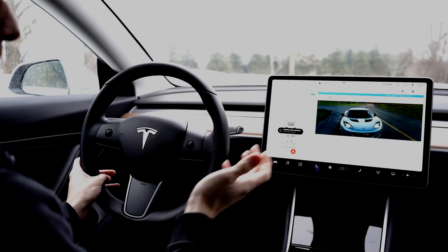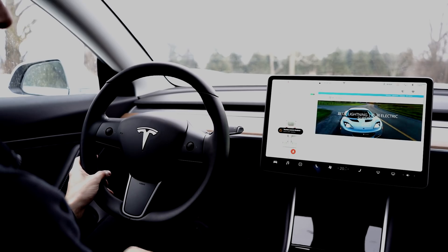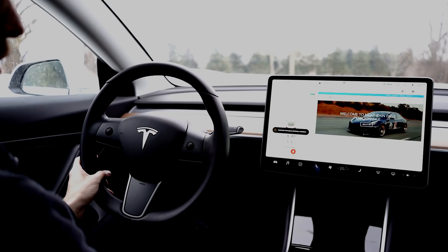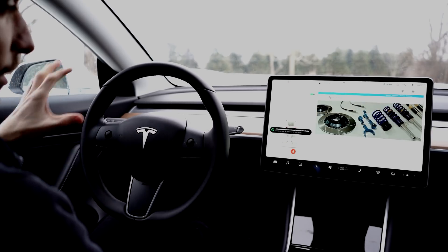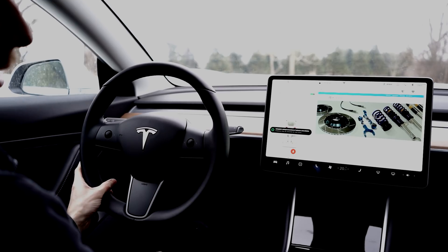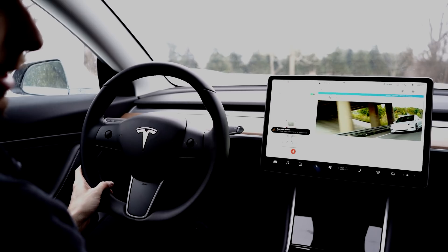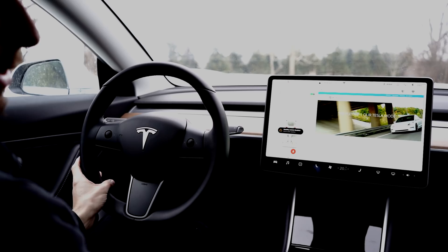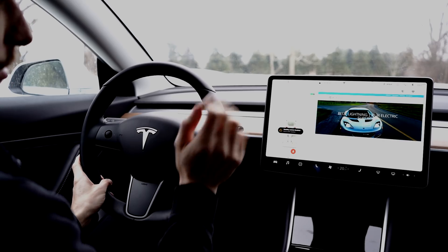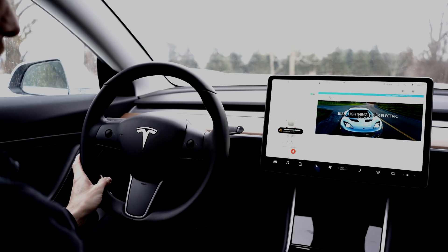One of the reasons we made our party box is that with no traction control in an electric car, you get crazy spin-up and it's hard to control the car, especially with an open differential. So we're going to do a little example here of dyno mode with basically no controls, and then our party box, which still has the e-diff — which works sort of like a limited slip — and controls slip to 30%. We'll spin around and see how easy it is to control each way, and you can watch and decide if we're being unbiased.